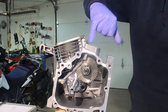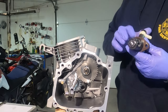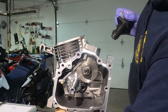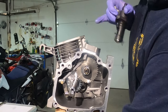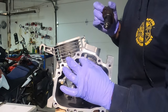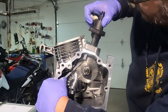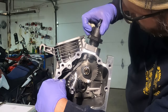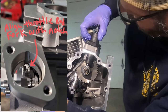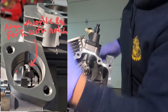You need to watch your arm — there's a groove. I've got my two gasket spacers in here. When installing this pump, there is a groove inside the case and then you have your fork down here that activates this. You've got to make sure that you slip it in and tilt it forward just a little bit. Push it as far forward as you can and that will slip inside that tuning fork.